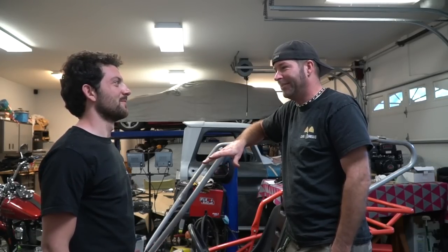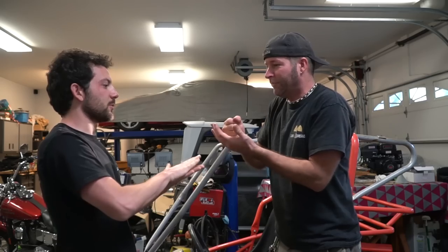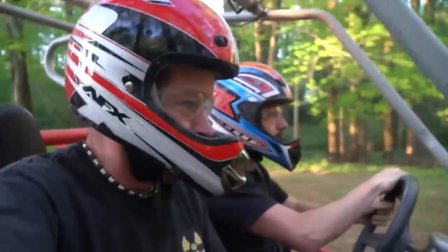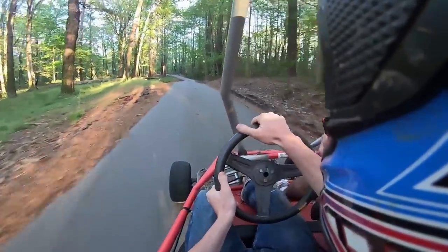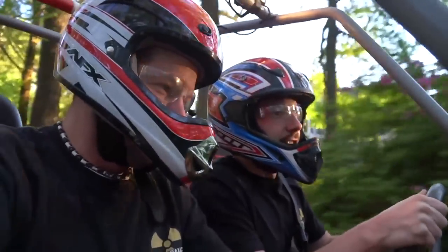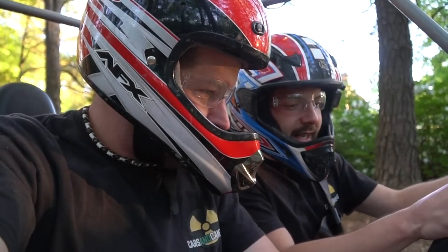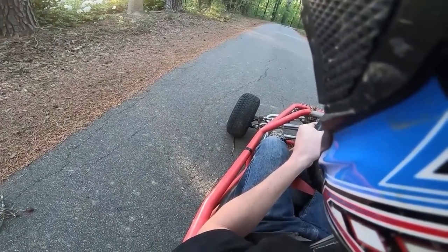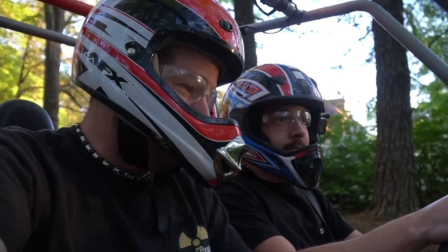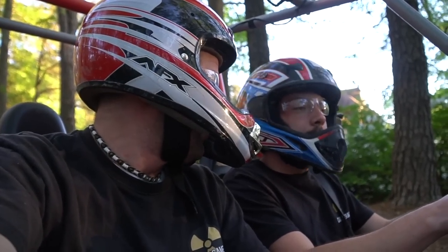Now that we've got this thing ready to ride, we'll do rock paper scissors to see who rides first. Got him! The top speed was 32.3 before, now it's 32.6 — so we picked up 0.3 mph. Something's not right though; I heard and felt a clunk. We made the alignment worse, which is going to cause it to slow down. We probably did gain some more miles per hour, but the toe is way off — terrible. It doesn't matter as much in the dirt, but it'll wear the tires.